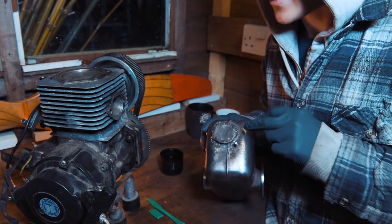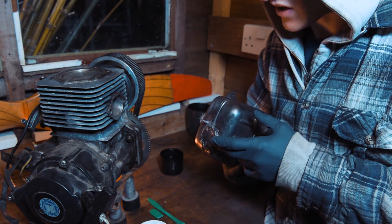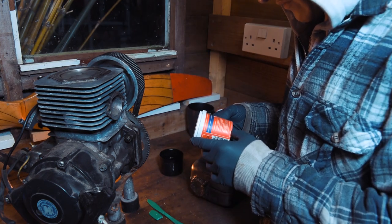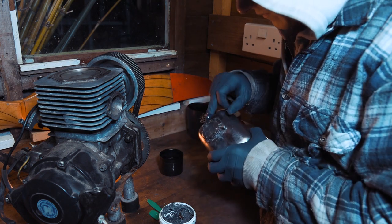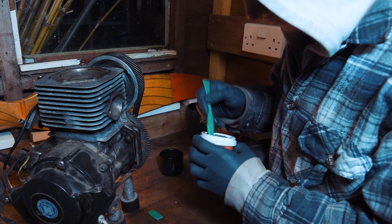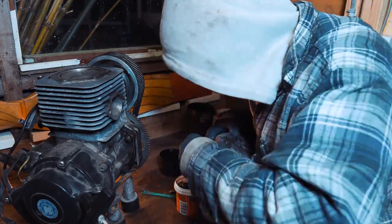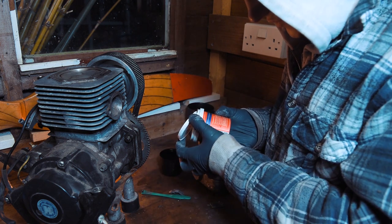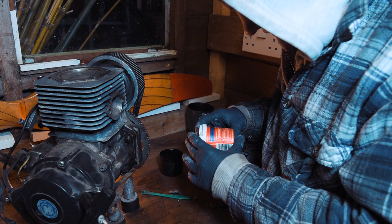There's something oddly satisfying about that. Now that we've got this cleaned up as best we possibly can, we're going to put some exhaust putty around there to try and even it out. Someone has obviously tried to re-weld this back up and they've done an absolutely terrible job. So what I'm going to do is stuff putty in there as much as I possibly can and smooth it off so it looks nice. Ensure the repair area is clean and free from loose rust — done. Moisten repair area with water and apply putty with a knife. I'm pretty happy with how that's going on. Start the vehicle engine and allow it to idle for a few minutes — this will accelerate the hardening of the putty and ensure excellent adhesion of the putty to the metal.